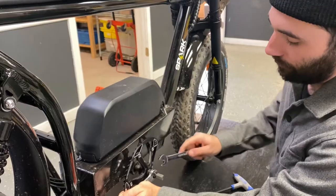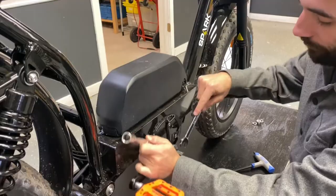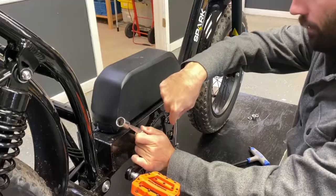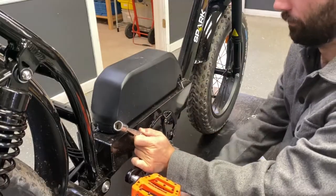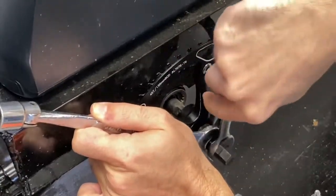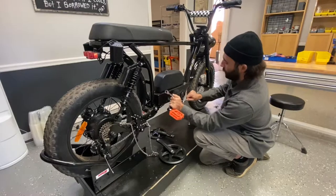You've got your larger wrench on the inner part of the nut and your smaller one on the outer, and while you hold the inner in place you just want to turn — for me this would be clockwise. And that is what is pulling the whole thing off. Now we should just be able to pull it right off.